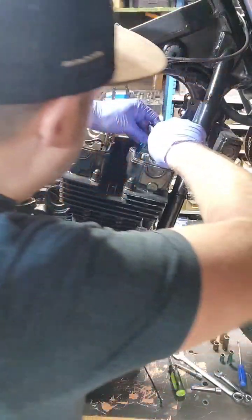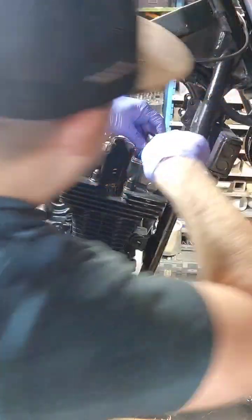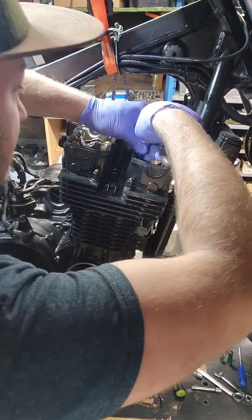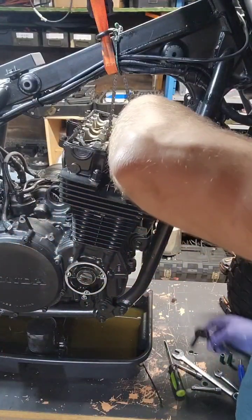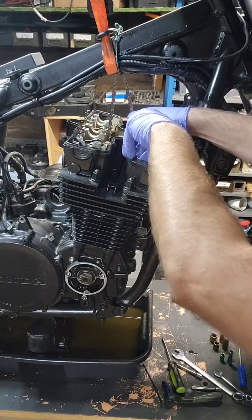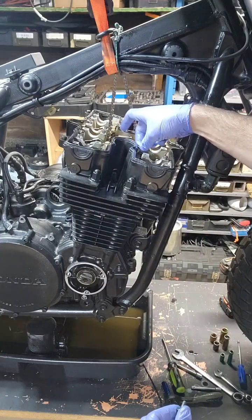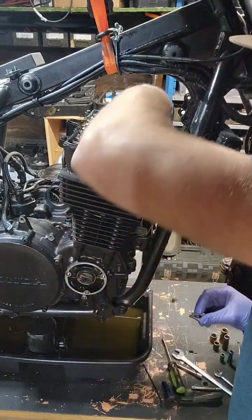I can take off the holder so we can keep track of this as well. These are just hand-tightened with a quarter inch. To put them back on, it's somewhere between 10 and 12 foot pounds, so not much pressure is used to keep these in. I'm just going to get these off by hand. There we go — got all the washers.